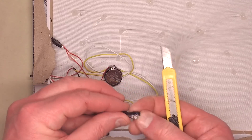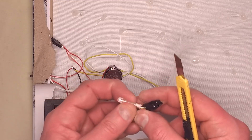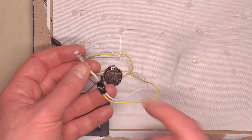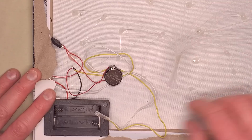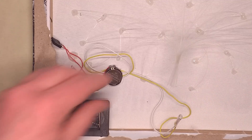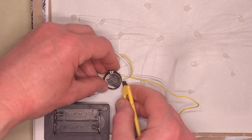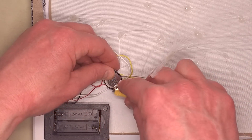That is just a standard 5mm style LED. They've got that sort of standard Christmas light spacer material and then the wires sorted on — it's got a loop out as if it's designed to maybe run multiple LEDs. They might have a chain of them that they just cut to length. If they've got more fibre optic points — because the bigger pictures did have fibre optic points — they may actually have just a number of these looped in parallel for each cluster of fibre optics. This does open up the possibility, with careful work, of going in and putting in a different colour of LED if you want it.